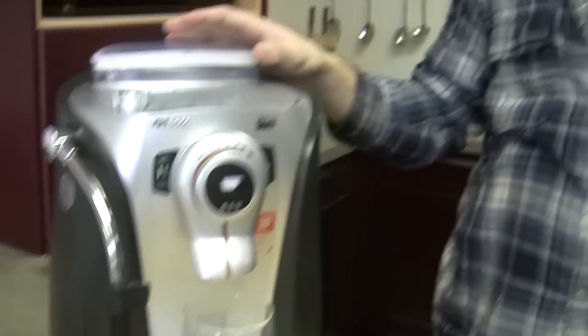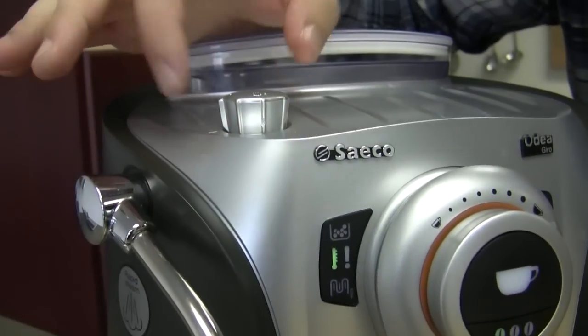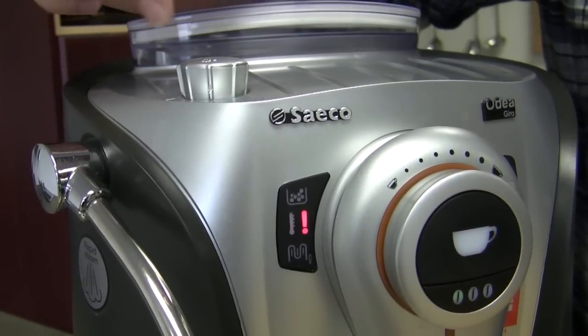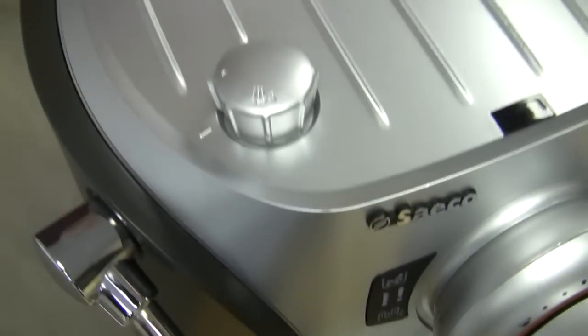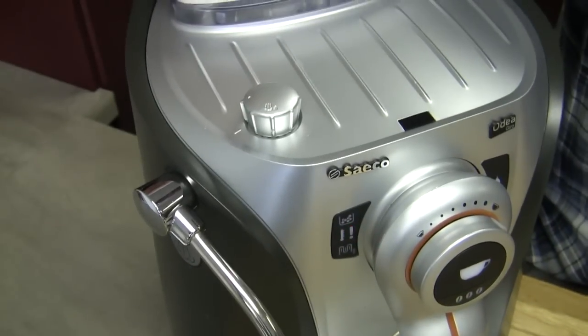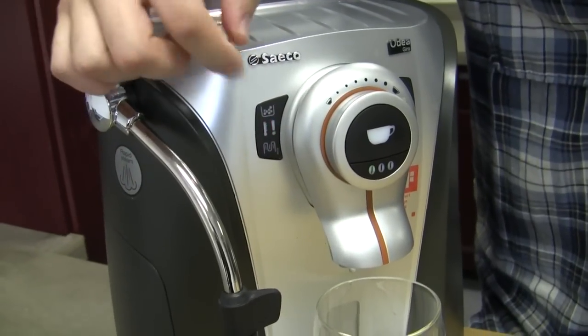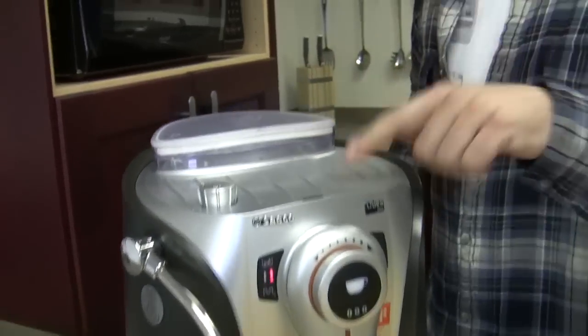So for example if you're getting just a steady flashing light that can be one of a number of things, and we're gonna go through those things right now. The biggest one that confuses a lot of people when they first get their machine is the fact that their steam knob is somewhere between closed and open. As you can see, I'm opening this as a small amount as I can — and now we're getting an alarm. If someone just got this machine it would be hard for them to tell that their valve is actually open. Right now it's just as close to being closed as possible but it's not actually closed, and we just get this steady light. That rate of alarm is telling you that one of five things is happening.